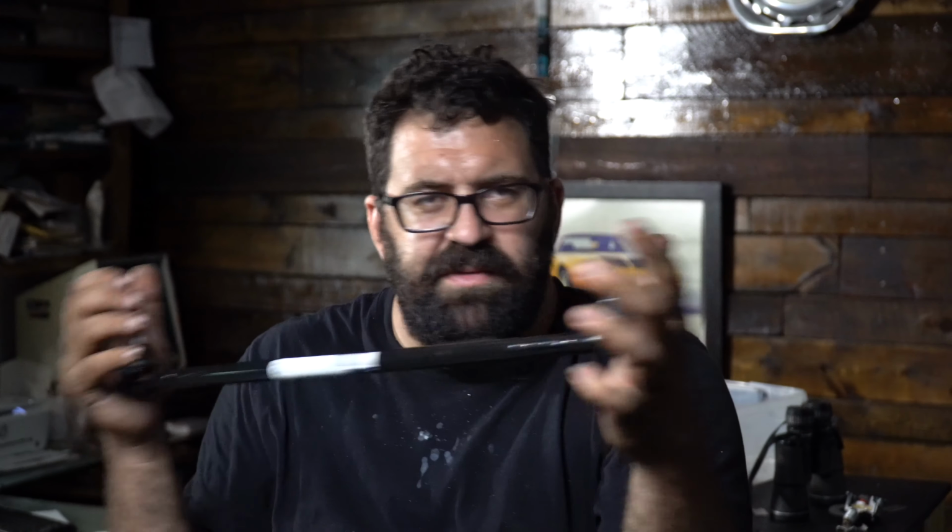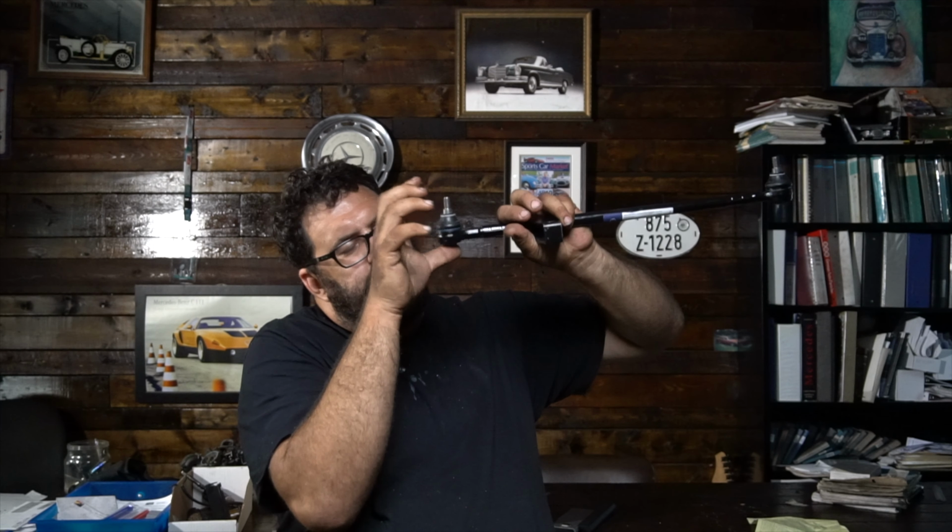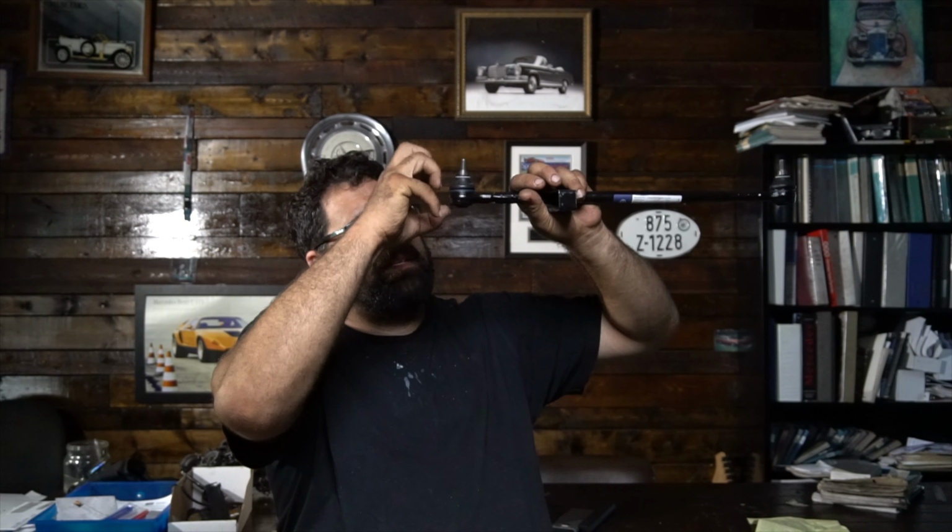They should be smooth. But what they should not have is a ton of wobble when you push them from side to side. And if you grip the receiving member and the base of the ball joint with a giant channel lock, it should not compress in. It should not be squeezable. And if you see a broken boot, again, just replace the member. It's usually a sign that thing's been exposed to road dirt, especially if you want the car to align right and feel right.